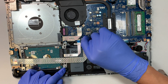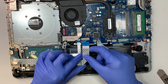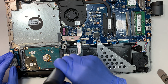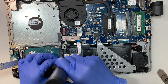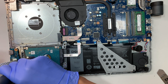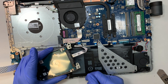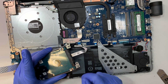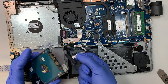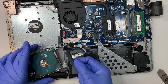To remove the hard drive, first flip open the little safety clipper on the flex cable connector, then pull the flex cable down toward your body. Next, remove the three screws holding the hard drive bracket. Once those are out, disconnect the connector that attaches to the hard drive — there's nothing locking it, just pull it carefully. Do not break the cable or the connector; pull it slowly.